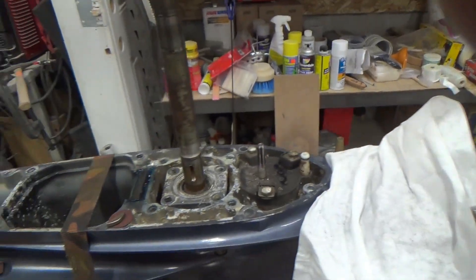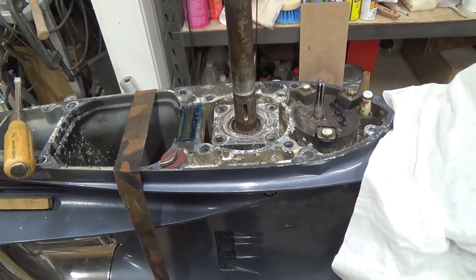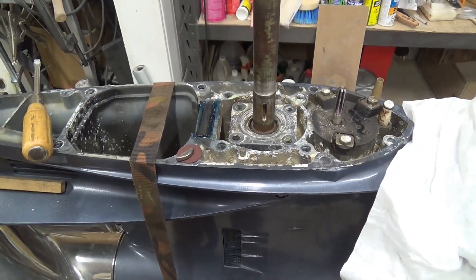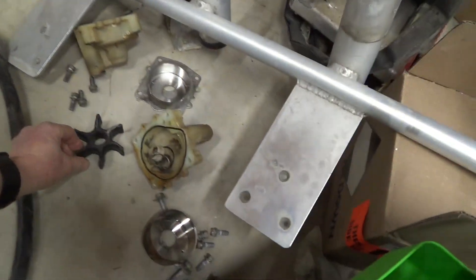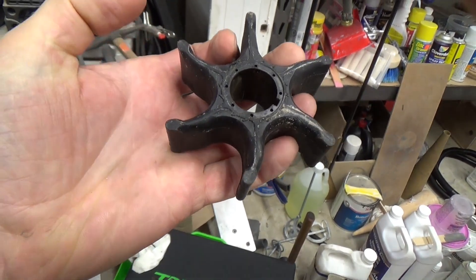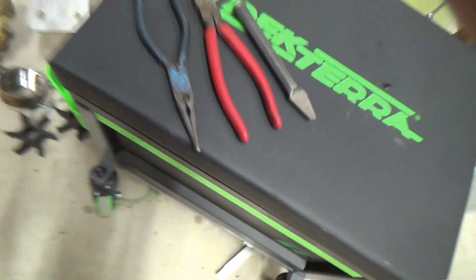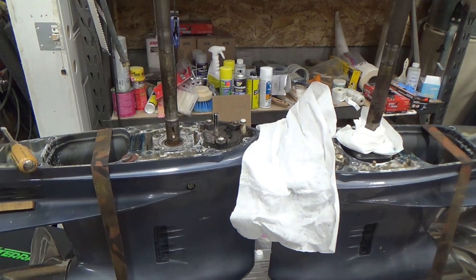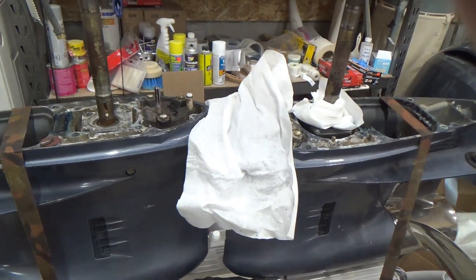I had to do the same thing on both shafts. Now I've got the seal carrier loose — this week I'm going to replace the seals and the retaining washer, then put all new parts back into the impeller. The impeller fins are pretty worn; the little ridges are worn right off. On my starboard engine especially, it took a long time for the telltale to show up, so I knew the water pump was getting weak. I'll get some parts this week and get that sorted out. Thanks for watching.